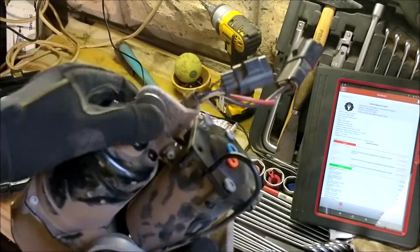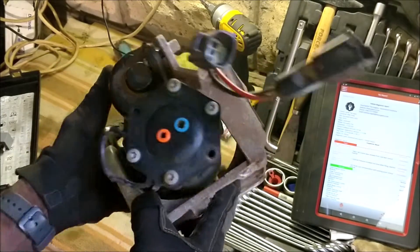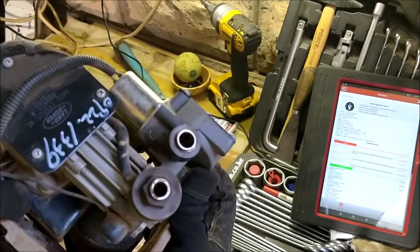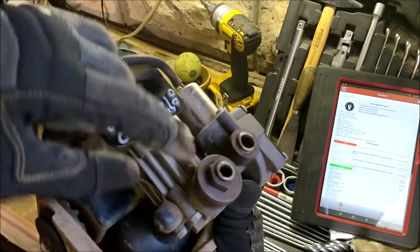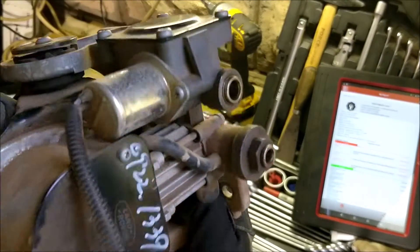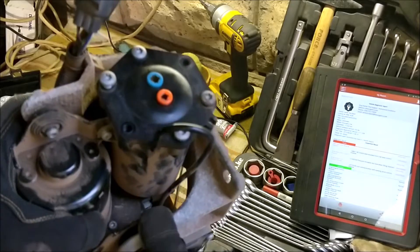So this is basically how the compressor assembly looks. It has two airlines on the front face and two at the back. They are push-clip type airlines, so when the pipe is in place you push these little clips to release the pipes. With some struggle you usually get them out, especially on these ex-UK vehicles that have a lot of corrosion all over the place.